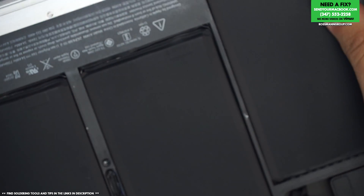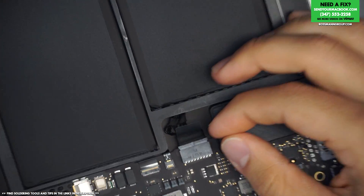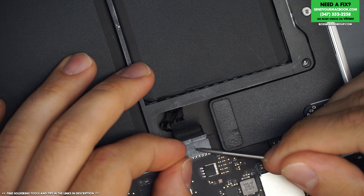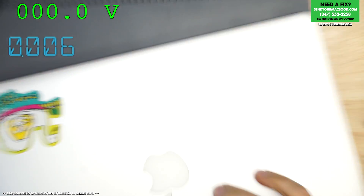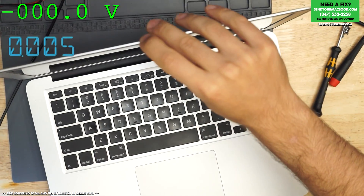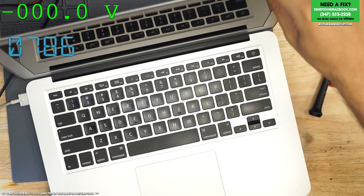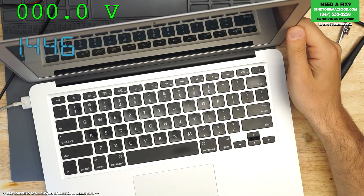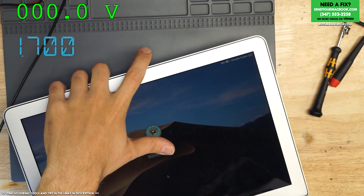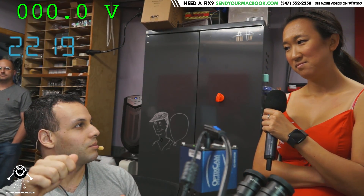As I just showed, when we got this in, this is the battery, and it was sitting like this. So it needs to be all the way in there. Watch this little plastic piece in the middle - when I push it, now it's plugged in. That's why it's not running off the battery. The board itself takes 500mA, so anything over 500 in this number is going to be the battery charging and working. Got a happy little Apple on the screen - it's 58% charged. Before it would say X because the battery wasn't plugged in.